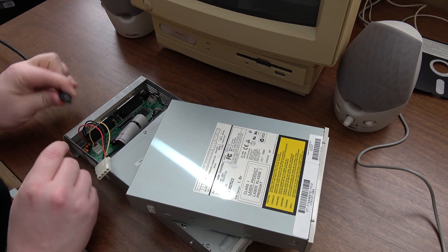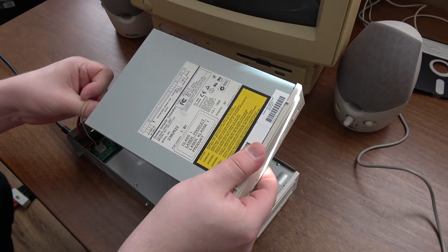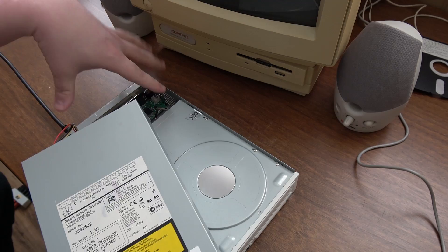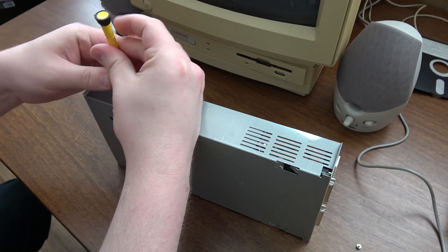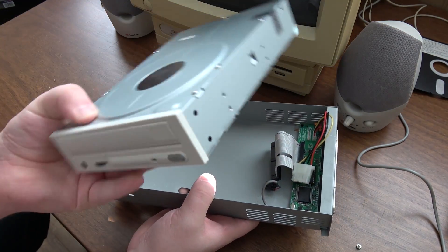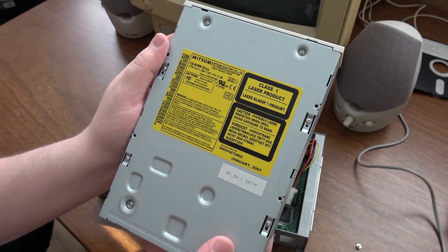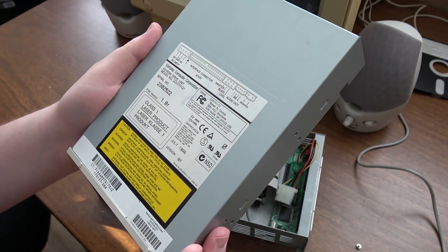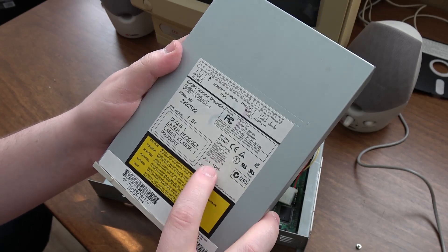Just as a test of this board, I'm gonna plug it back in. So the circuitry here is perfectly fine — at least the power portion of it is. And that's it. Just four screws and it slides right on out of there. What is this thing? It's a Mitsumi, January 2001. Gonna replace it with this Compaq unit, which is 32-speed — July of 1999 is when this one was put together.